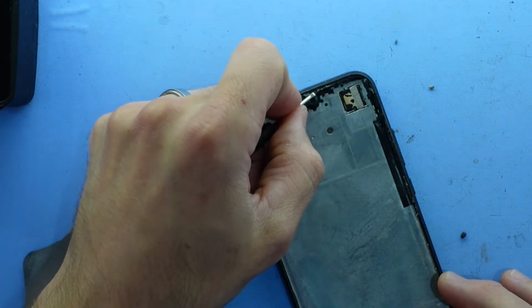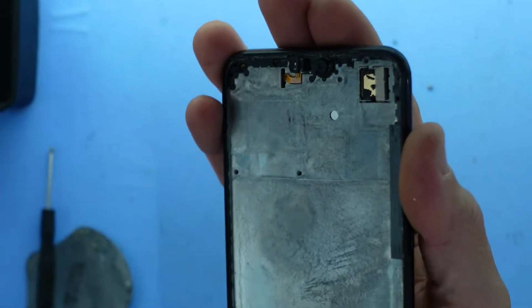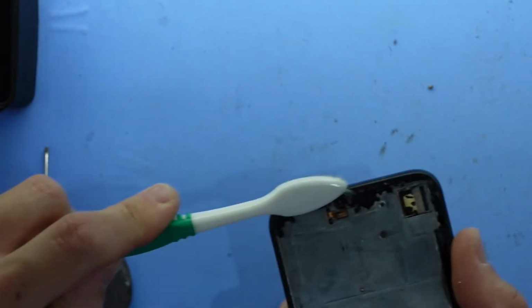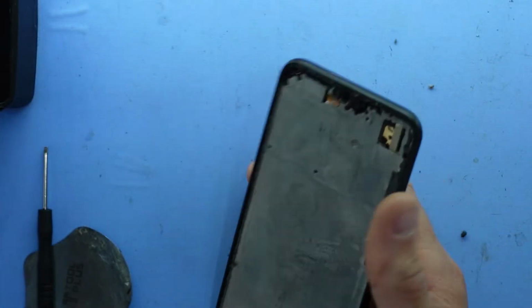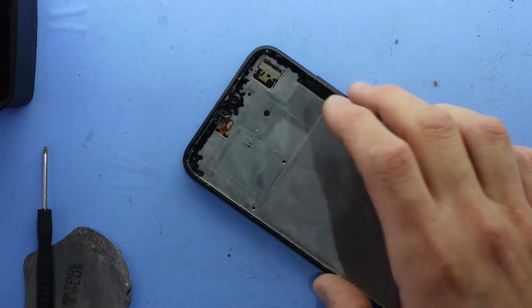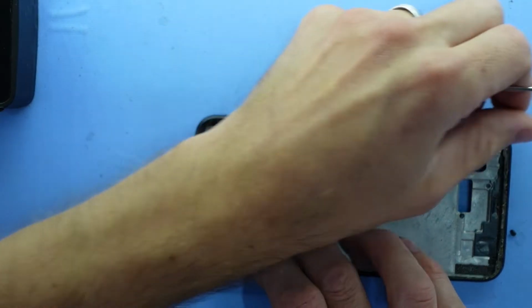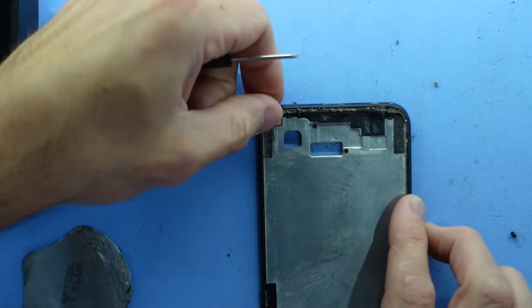There is also a little sensor right here. Very difficult to see it in the current lighting. About here there's a small speck, so I'm not sure if that's an ambient light sensor as well or what its actual purpose is for. But being on the replacement screen, you can see a small speck just here. So basically, not to cause any issues, you try and use a minimal amount of glue in that location, or else you may have dramas later on with the phone. But you really don't want to have to do this job twice. Well, then again, most jobs you don't want to do twice.